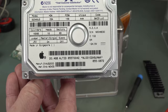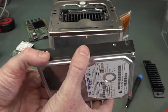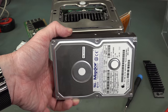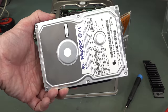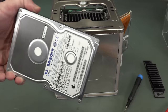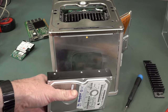It's way out of warranty anyway. People upgrade these with solid-state drives, because this thing is bloody noisy, let me tell you. It's so annoying - I would actually prefer to have a fan in it to give some low-frequency drone noise, just to get rid of the high-pitched crap of this. Listen to it. Yeah, it's probably the bearing starting to go on this puppy - probably didn't sound like that originally. But the hard drive is really quite annoying.